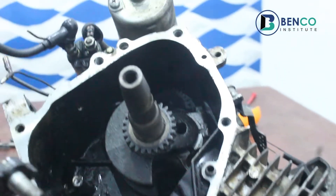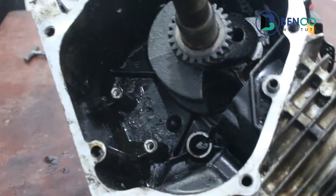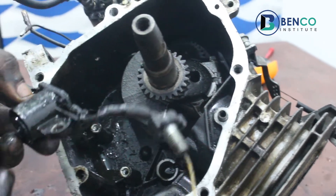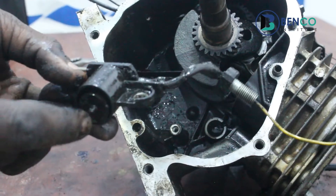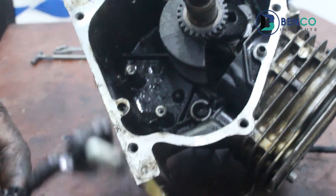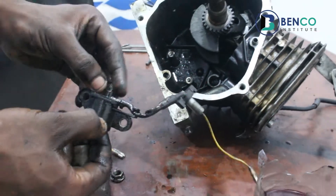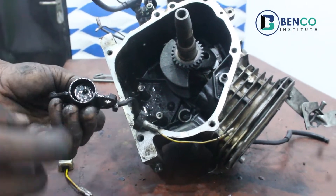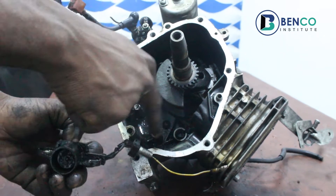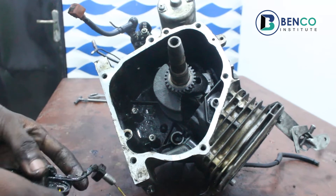This is the principle of how an oil switch works. Because the oil switch is connected to the crankcase, it works this way: when there is oil in the crankcase, this knob — or whatever you call it — is supposed to go up. When there's oil in the crankcase it goes up, meaning it cannot touch the body of the crankcase.